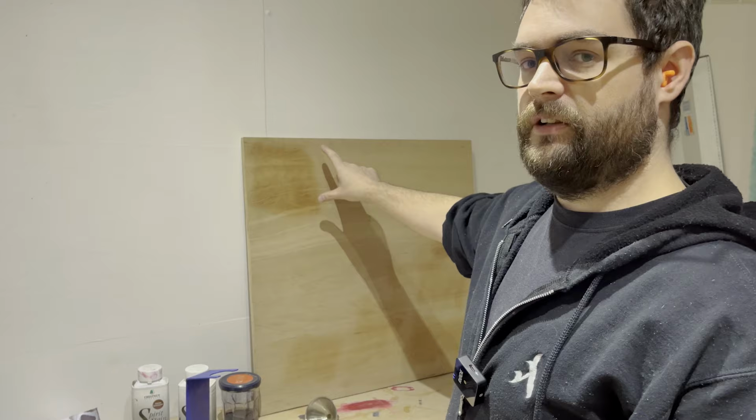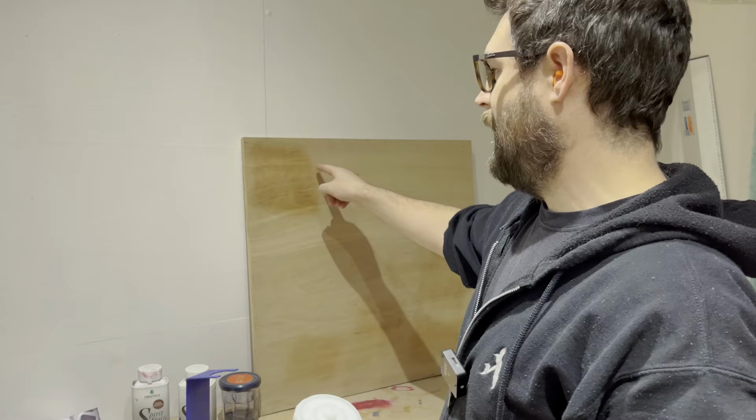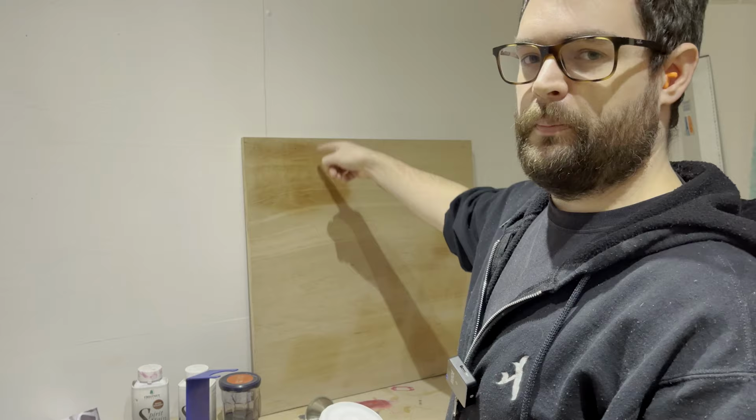So we've got an amount of paint that's spread over quite a great distance. And the trouble is, this stuff here is quite dry. When we overlap, we'll get sort of dry patches. So we'll spray another one next to it. We've got two dry patches here, and that's how we end up with orange peel.